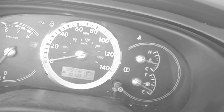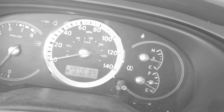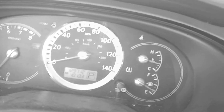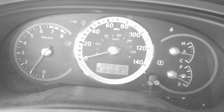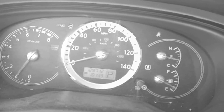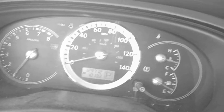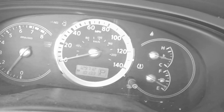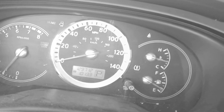So this is just a reminder: when you see that security light, something's going on. If you've got a security light that flashes when you put the key in on the Nissan Quest, you need to cycle the alarm system on and off five times to clear it out, and you should be good to go. That takes care of the crank no start.